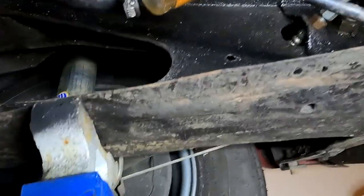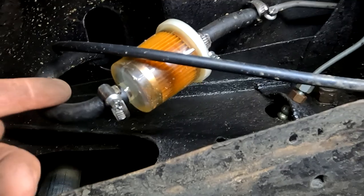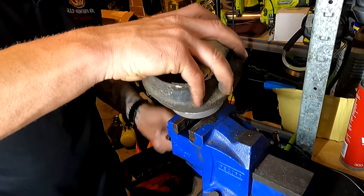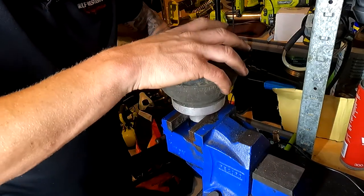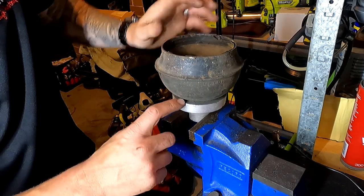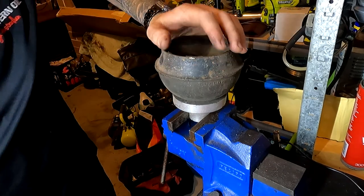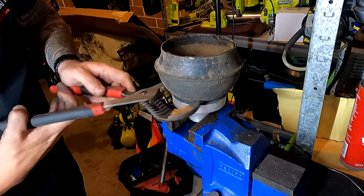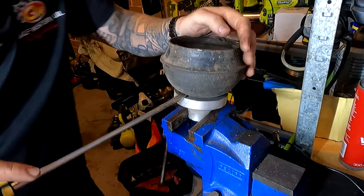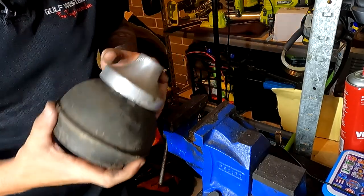This is also a good time — if you haven't already, make sure to check your fuel filter and see what condition it's in. If it's got a clear bowl like mine does, you can see straight into it. If it doesn't, it's pretty cheap to replace, so make sure you get that done. This is where it becomes fun as well. I can put a rag in there just to help keep it still, but I'm hoping I can apply enough pressure and then get a screwdriver or lever bar in here and take off the cone, or even get a pair of multi-grips around the outside to try and twist it. These are the biggest multi-grips I've got and I don't think that's going to work. So scratch marks all over it is. I'll show you a really good trick in a second to help prevent this from happening. That is well and truly stuck on there, so I'm going to have to give it a bit of persuasion.